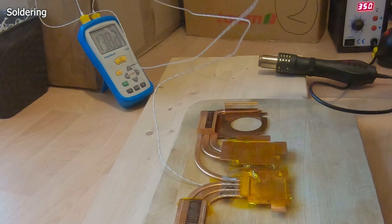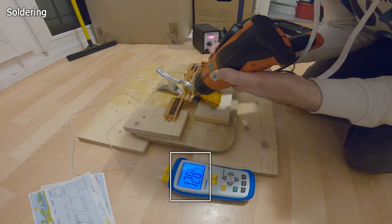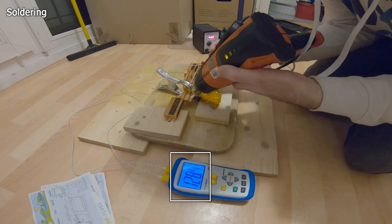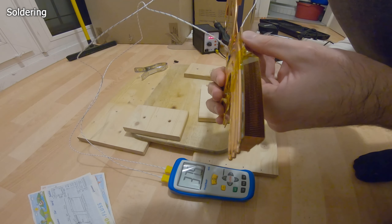The resoldering was done with very similar low temperature soldering paste typically used for heatsinks. Because there is not much wiggle room between the heatsink and the laptop's frame I tried to align the new coldplate as precisely as possible. The resoldering process was much easier and quicker because the thermal transfer between the coldplate and the heat pipes was much worse with the paste in between them than with the solid solder connection. As soon as I reached the melting temperature range the temperature dropped off quickly, which I took as the indication that the solder paste had melted. After the heatsink cooled off I confirmed it had melted indeed and the resoldering was successful.